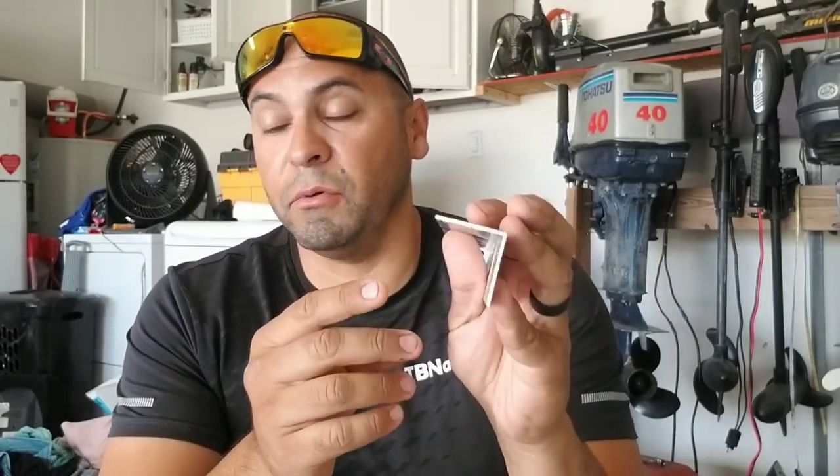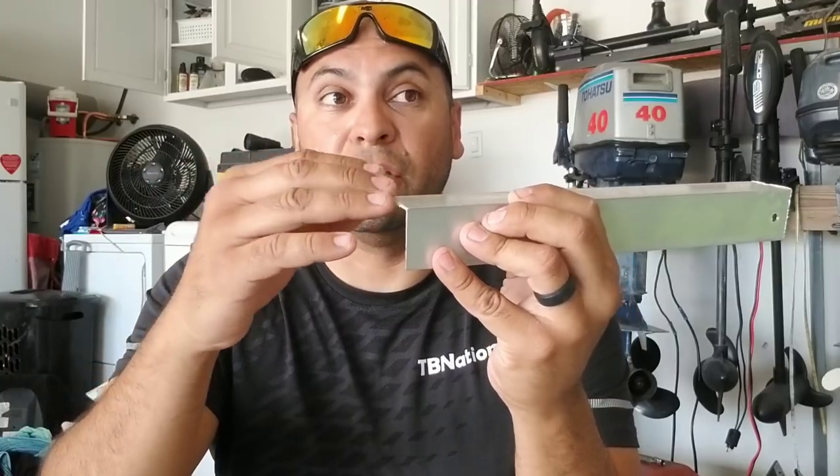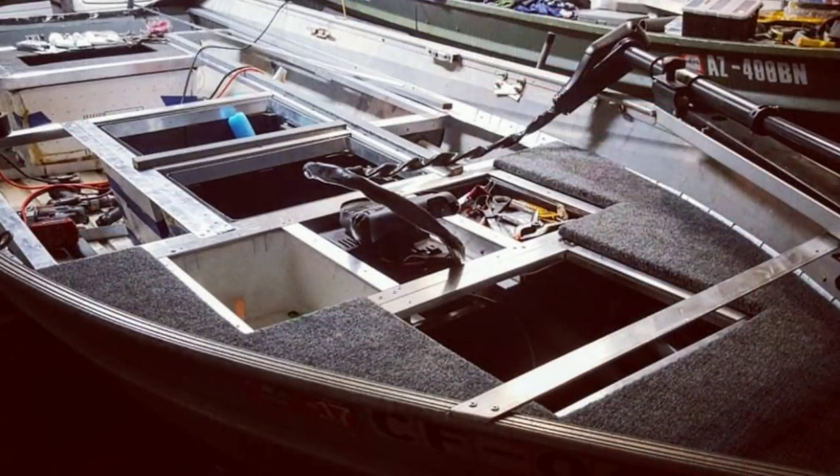Drilling and riveting 1/8th inch takes hours. If you have the skill of welding it makes more sense because you can get rid of the overlay. The other reason I love 1/16th is you can overlay it on top of each other and it doesn't create a gross gap that throws off your hatch. The 1/16th on top of each other is skinny enough that you don't notice the difference - the carpet around your hatches bunches through there so you don't see it. But you will notice it on thicker frames where you have to put a flat bar to compensate.